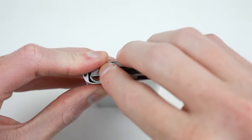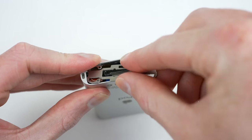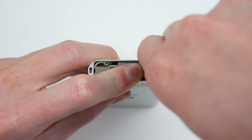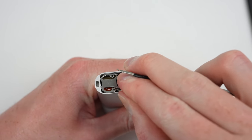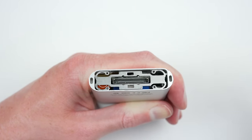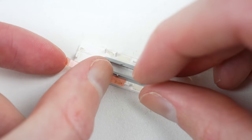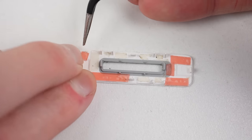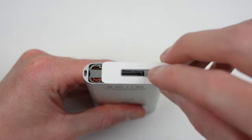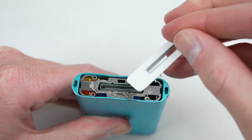At the bottom, the metal retaining clip can be reattached. This was almost as challenging as getting it off, as I needed to find a way of properly reattaching it without damaging the cable below. I started with the right hand side and after it was attached, the left side went in a lot easier. As for the plastic piece, it needed new adhesive applied. After scraping away the old glue, new strips could be applied before the piece is reattached to the iPod. Firmly pressing it down back into place, this completes the first iPod — with one down, there's two to go.